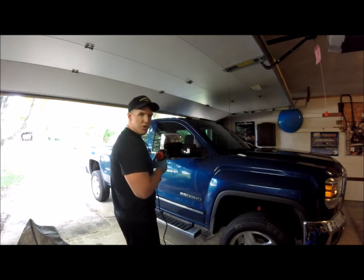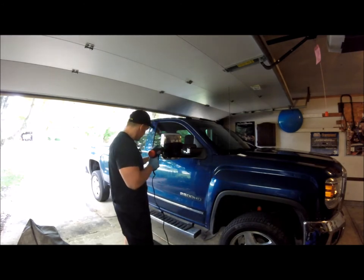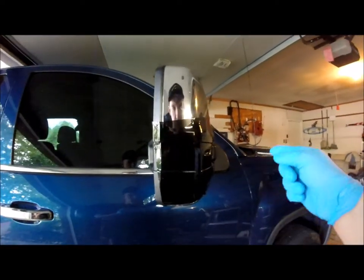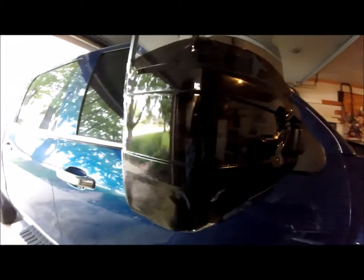When you're doing this, be sure to use the lower setting on your heat gun so you don't burn the vinyl. Alright, we're done with the heat gun and as you can see it looks pretty good. We went ahead and carefully went back and forth over the vinyl on the low setting, and it adhered pretty well — not very many air pockets. This tint was actually very easy to work with; I gotta say I'm pretty impressed.